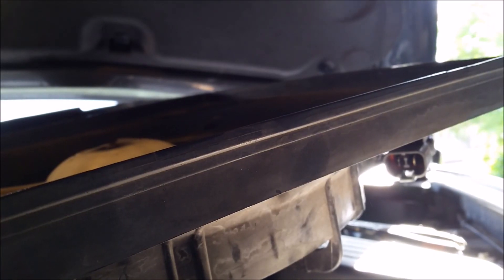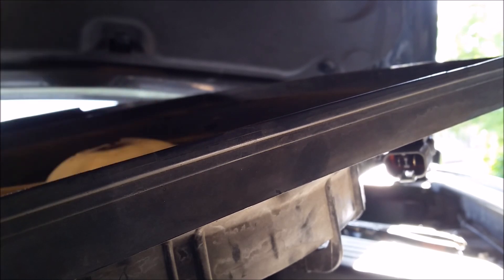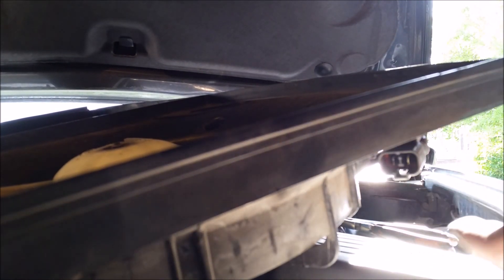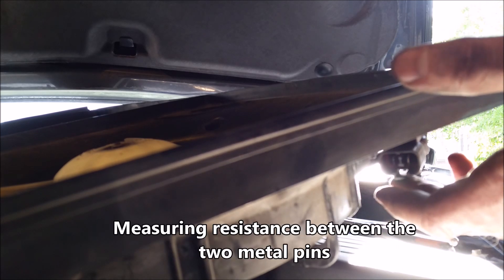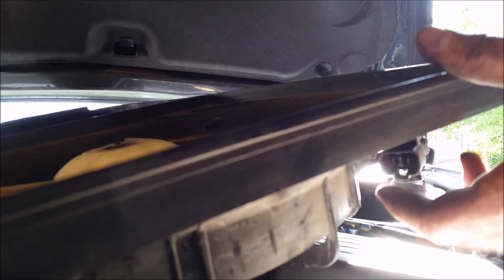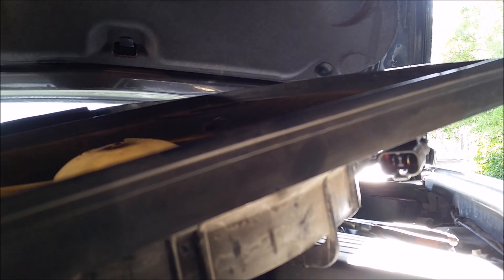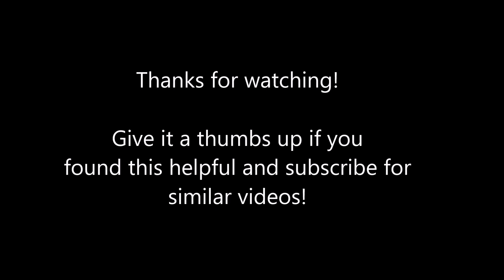The reason I needed to change this in the first place: the radiator fan on the driver's side stopped working, and I didn't realize that until I tried to change the coolant. During that process you need to wait until the fan comes on, and it wasn't. One way to check it is with an ohmmeter on the plug terminals for that fan motor. It should read about four to seven ohms — my new one reads at seven ohms. The condenser fan is about two and a half ohms. The old one read open on my ohmmeter, meaning there was no continuity.